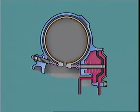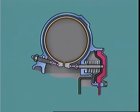The speed of band application or release is controlled by the rate at which fluid on the release side enters or leaves the servo. When admitting release fluid is unrestricted, the band is released quickly. When dumping it is unrestricted, a snap band application occurs. This is because fluid under pressure is already acting on the servo piston.